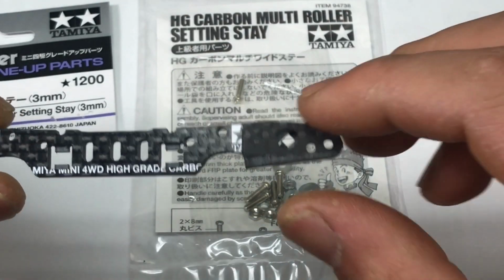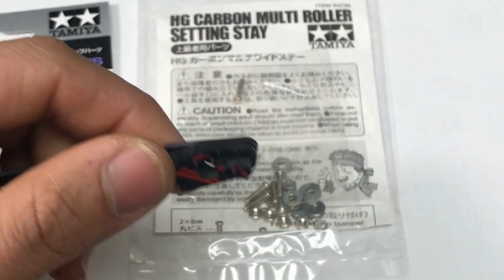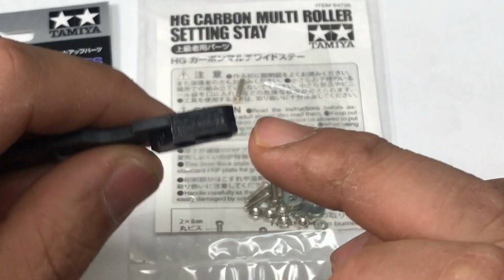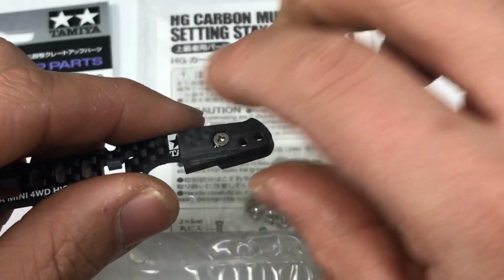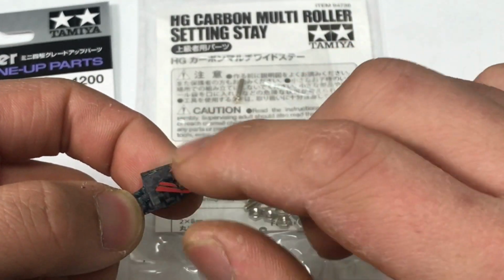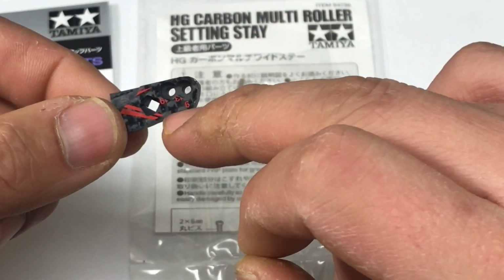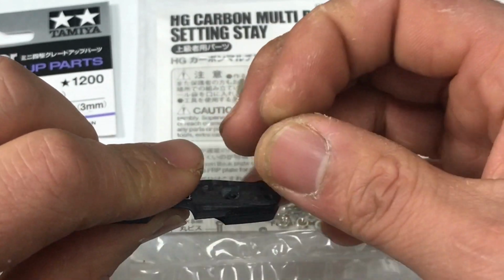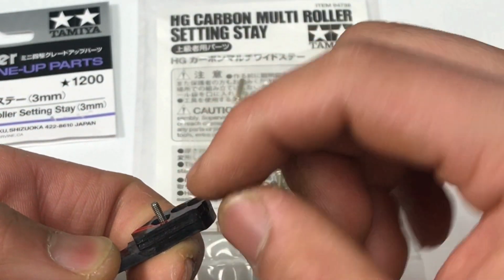The other thing is you can see the holes over here. There's an underguard, and this hole is basically for us to tighten the underguard. Even though we're already using crazy glue to attach the underplates and this underguard, I would like to have screws to make the underplate more secure. Here I have a hole. You just need to put in a regular nut and tighten it. One thing I suggest is to measure the size you need for this hole and the regular nuts first. Then you put it in and put the nuts on and tighten it, and then there will be no extra. It will be just enough for the bottom.